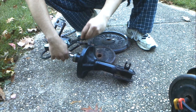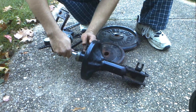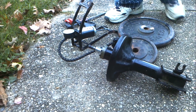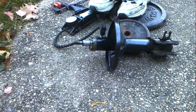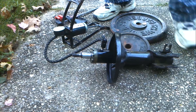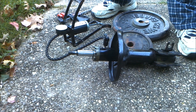There are some great videos on YouTube about that. What I'm going to do is take my air pump and pump up this shock to 250 psi, to give the complete effect of a new nitrogen-charged shock. As you can see, adding air causes that new shock effect of having the piston rise out.